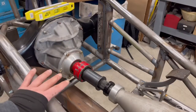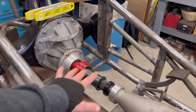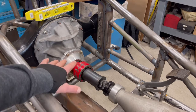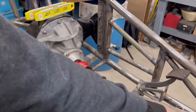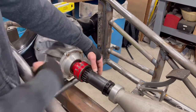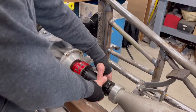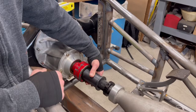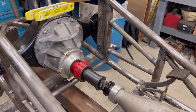When we're doing different things with the chassis up front — the arms, engine plates, motor mounts — we're always going back and checking the alignment of everything from the pinion through the coupler, straight through everything else. We're making sure that our coupler actually stays in alignment — you see how it comes in and out nice and easy? If this is lining up still, we know everything else is straight. Everything's nice and straight. Jimmy's going to go get those front engine mounts tacked in.